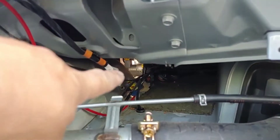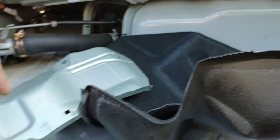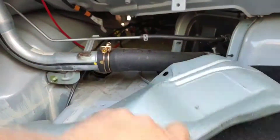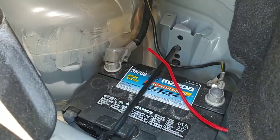You fish your wires through there and it ends up in the back trunk area. Now that you've got your wire passed through there, you can easily grab it with your hand and just bring it along the back. I took out all these bolts — there's a metal plate that protects the fuse inline — went underneath, followed it around, and I'm over to the battery.